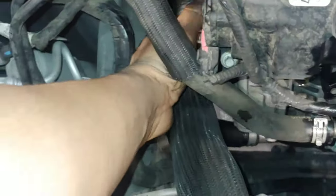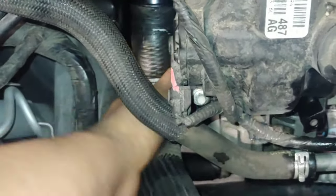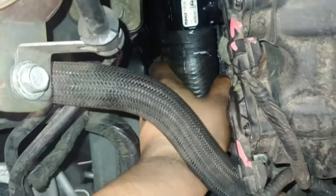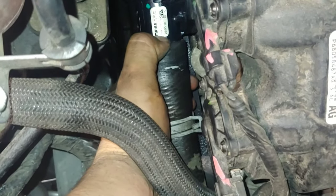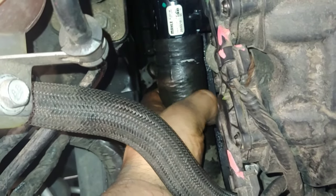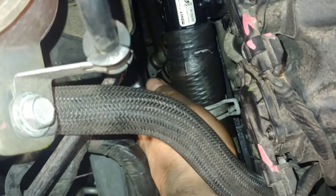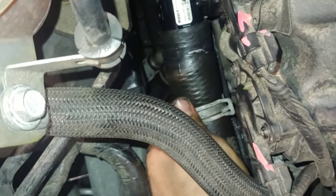Now I just got to put the radiator hose back into place and move the hose clamp up. Make sure the hose is all the way up — it's got this little stop right here. You want the hose to slide all the way up to that point. Just try to position the hose clamp on top of the grooves. You can kind of see where the hose clamp was at before you took it off, so just put it back in the same spot.